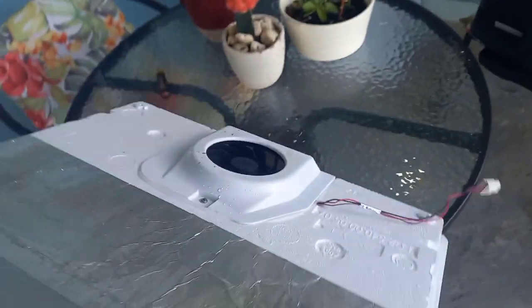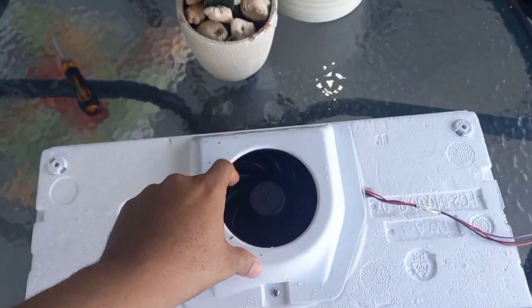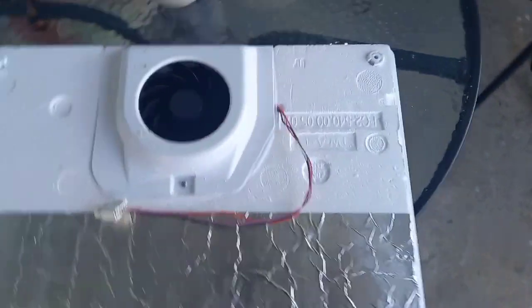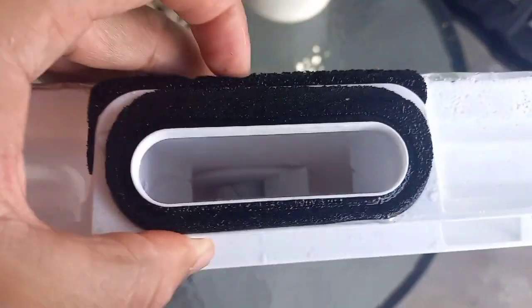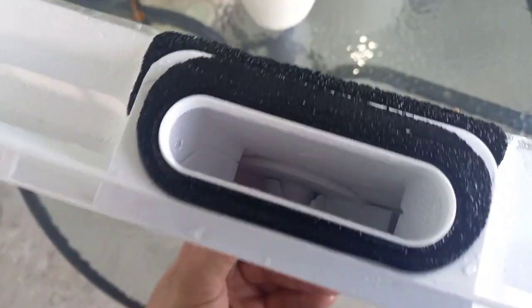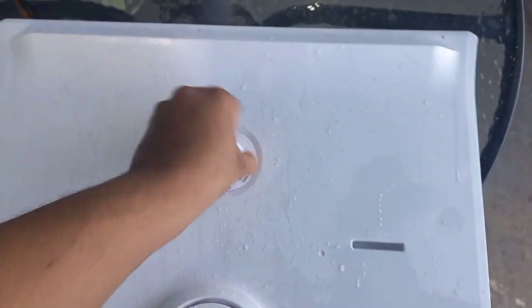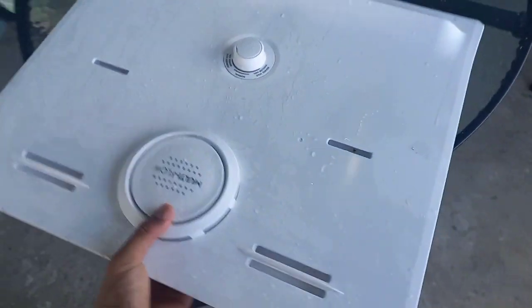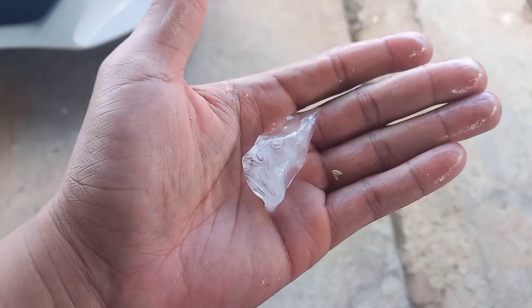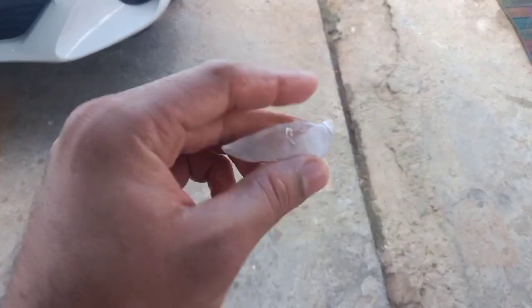In the back here is the exhaust fan, so the fan is working perfectly fine. This is the clip. The problem we are having is that if you look inside there, you will see the switch that I showed you that has to be turned — but it's ice that was holding it from turning. You guys can see I'm getting it to turn right now. Just this five minutes out caused it to defrost, and I knocked out the ice — it just fell on the ground. This is the ice that was formed inside that was blocking it.